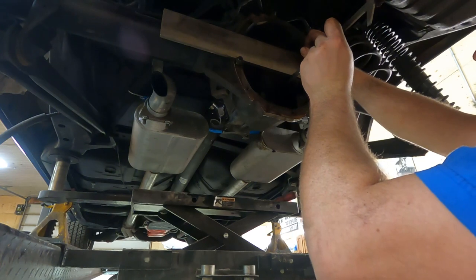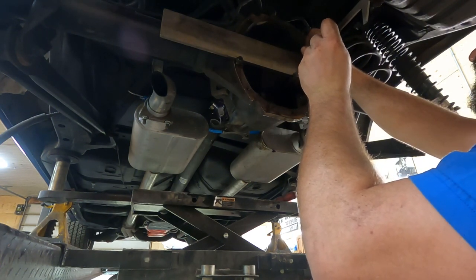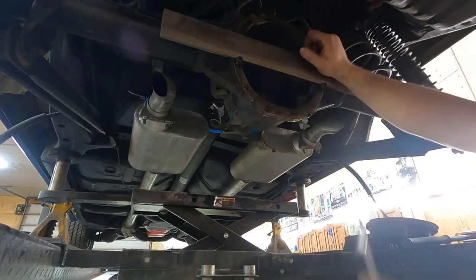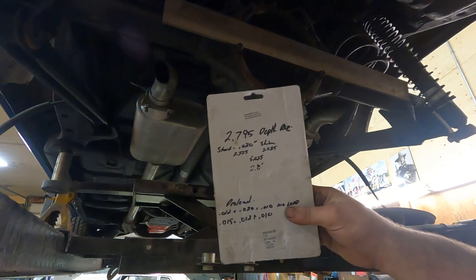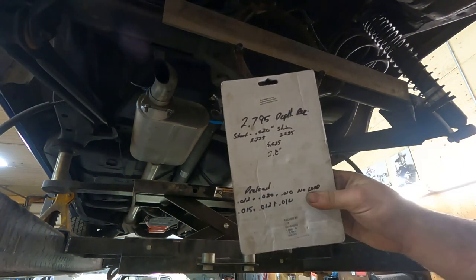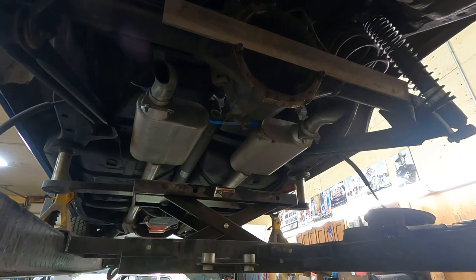And I'll measure it to my pinion. So we punch that into the calculator. There's what we get, 2.8 inches. We're shooting for 2.795, so we're within 5 thou.